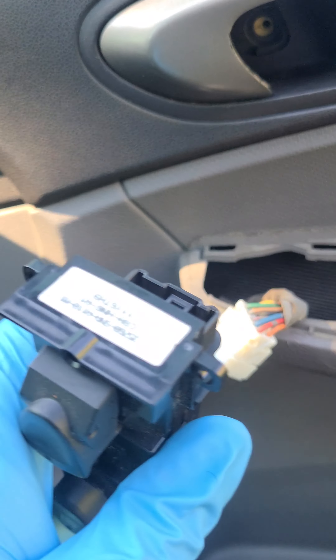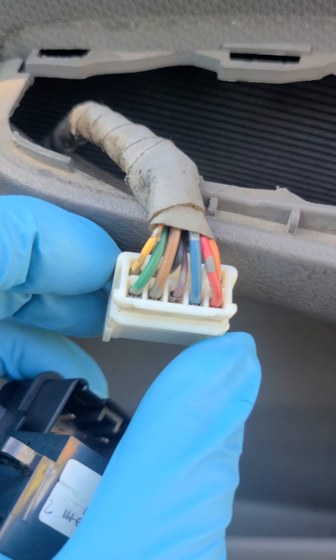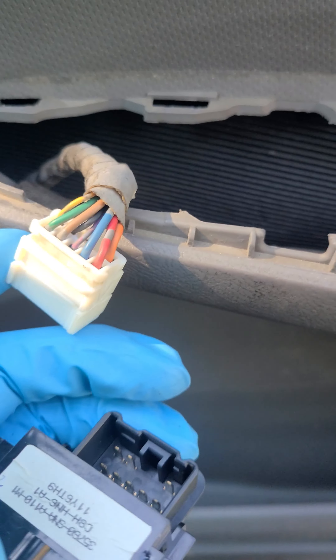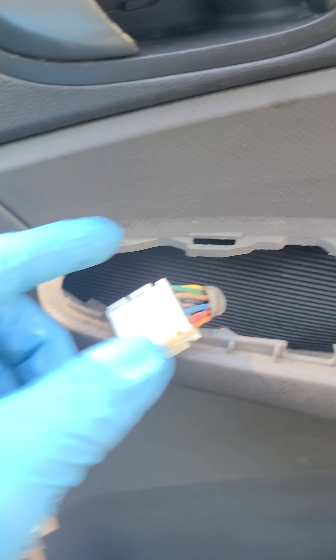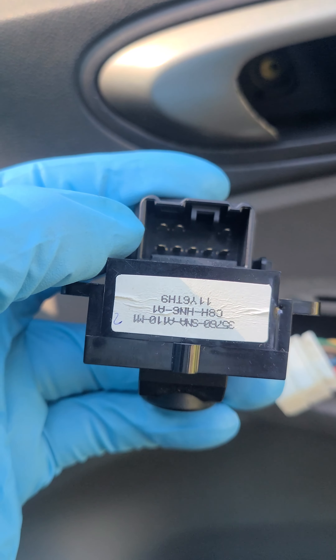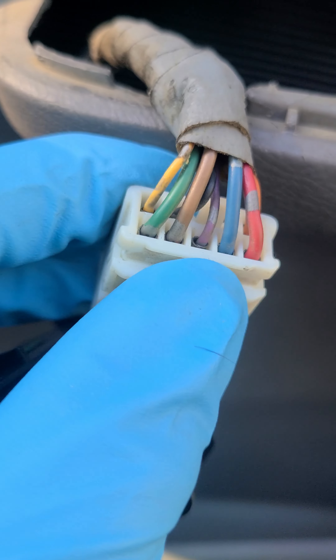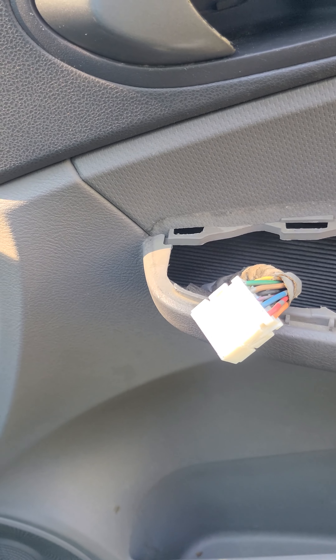Real quick, because some people are going to have questions because your switch is going to have a lot of wires and you're going to want to know which wires go to what. If you notice on your plug, some wires are going to be bigger and some wires are going to be smaller. The bigger wires go to your motor; the littler wires go to your lock. The motor needs way more voltage than the lock does, so you need the bigger gauge wires. On this particular one, you see there's eight plugs — eight wires — but you see how much bigger these wires are versus the other wires. That's how I know which five go to my window and which three go to my lock. Thanks for watching, hope that helps. If you have any questions, leave them underneath and I will answer as soon as I can.